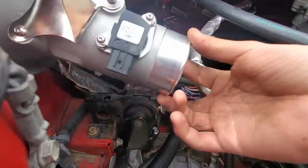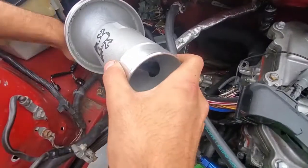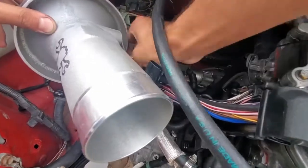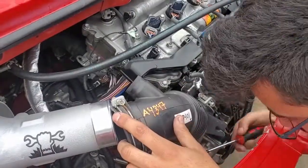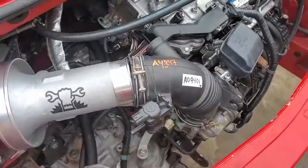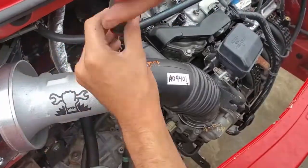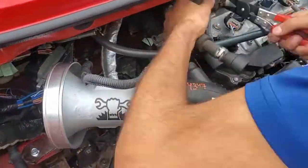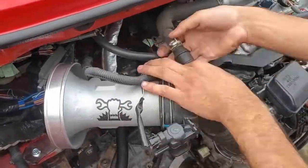Now you can install the mass airflow sensor, tube and bracket. The sensor bolts onto the tube and one of the screws on the bracket bolts into that third hole in the ECU bracket. The other spots bolt onto the chassis mount. The intake tube is the shorter version from the 2AR Camry. It has the purge valve opposite of the MAF sensor, but the harness is able to reach it just fine.